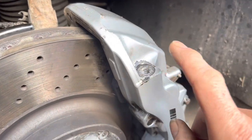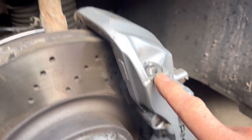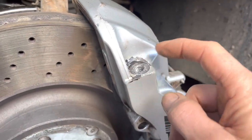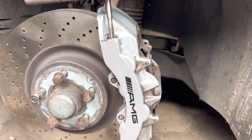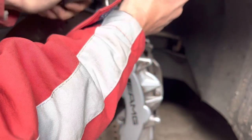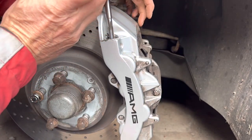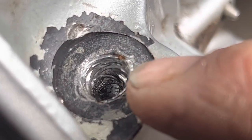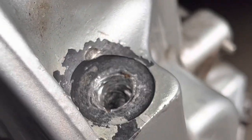The left-hand drill bit did not get that out, so we're now onto the option of re-threading using taps. I'm putting a magnet on there to catch any filings. Unfortunately I'm not cutting this evenly, but you can just start to see the edge of the rust being revealed — so maybe the last tap will do the job.